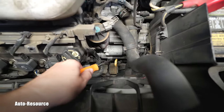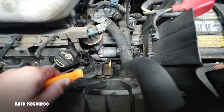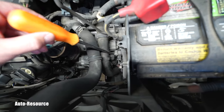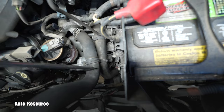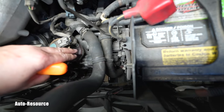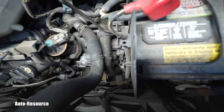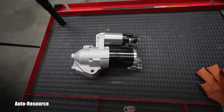The starter is right next to the automatic transmission dipstick. I have to work on the back right here, and these cooling hoses are in my way — I will be pushing them slightly to the left. I need to unhook two terminals: the small one for a signal and the large one which goes to the battery.